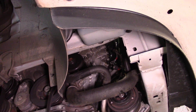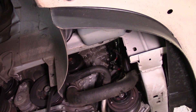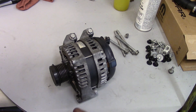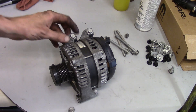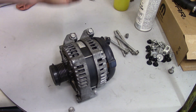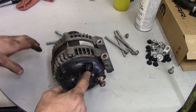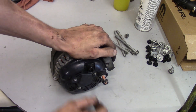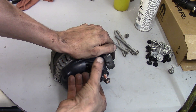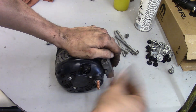So as you can see there's an opening we came out of. Now I'm gonna show you the alternator on the bench so I can explain where the bolts were. Here's our old alternator. You've got the stud that sticks through on the bottom here — that's the 13mm nut. And here are your two upper 13s I told you about. I was able to get in there with a short 13mm ratchet wrench and a long one as well. On the back side, you've got your connector — it's a two-stage connector. There's a red portion you've got to slide out towards the wiring, pull it back, and then once you've got it all the way out you can squeeze on the black portion and get it off. And then you've got your positive battery cable lead which you can get off with your 13mm as well.